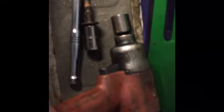Okay, the tools I'm going to need for this job are a 13/16 on a 3/8 drive shorty impact, and a heat gun. I've used a 10 millimeter short and a 10 millimeter long ratchet. This is, I think, a 14 millimeter on the oil pump drive. The slot was for the oil pump drive. I kind of forgot I had an oil pump drive, but I deleted that a long time ago on this ski. But that's what that one fits.